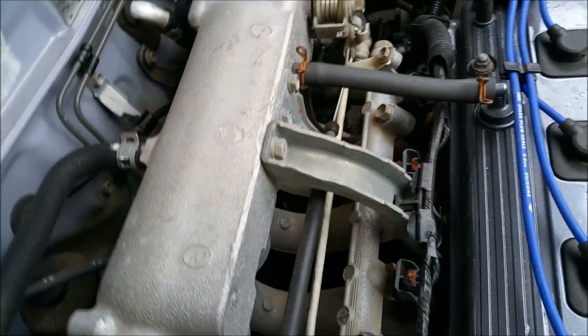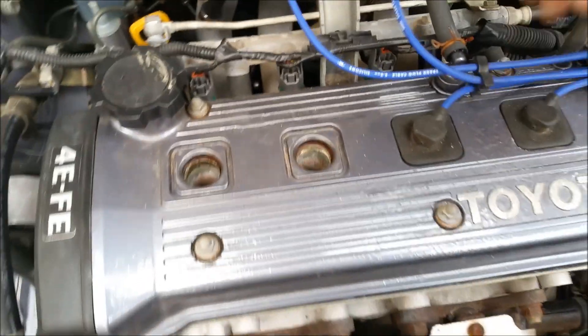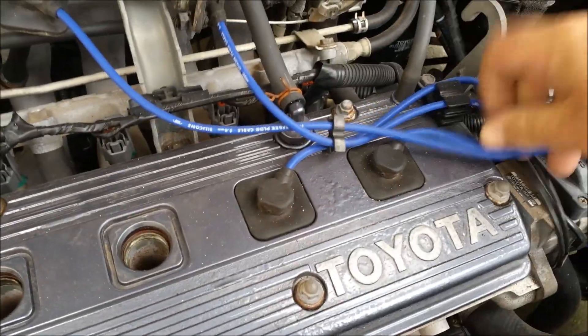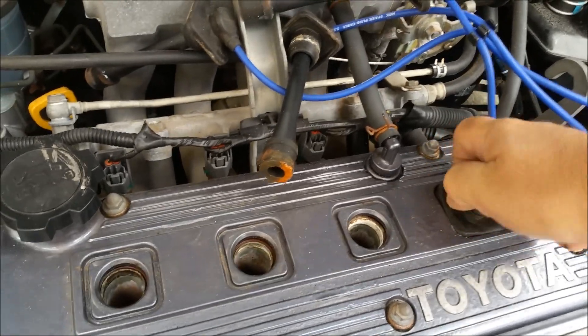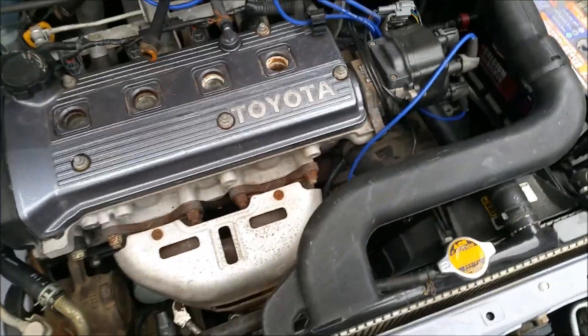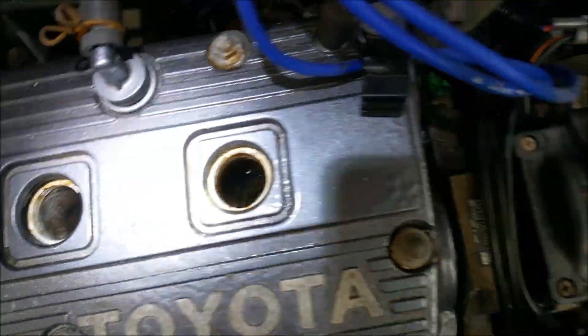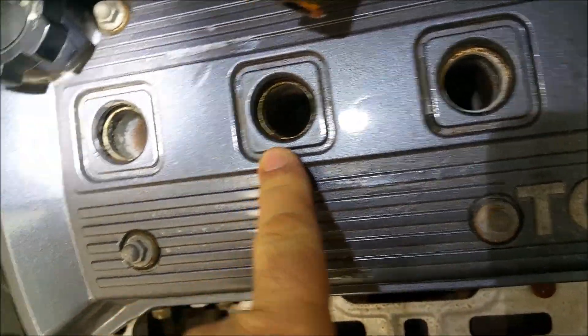These compensator lines I did put on. I think the throttle body is blocked. I'm going to pull this off. It's late Sunday afternoon. I can't get plugs at the moment - spark plugs. But I'll pop these leads out and pull the dizzy cap off and have a bit of a look. I don't like aftermarket - I hate it. It does look like water's got down there though. So there has been water down there. It looks like there's still water down that one. That will be our misfire, ladies and gents. I think I've found the problem.